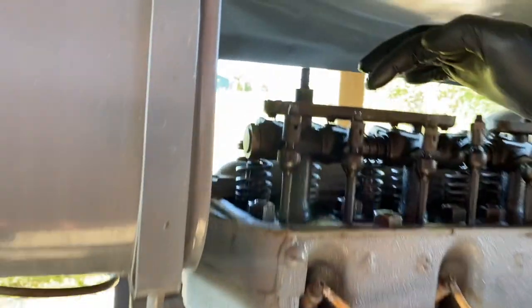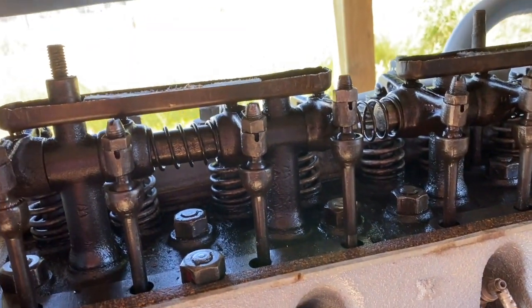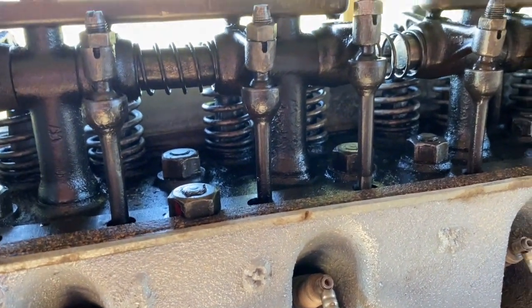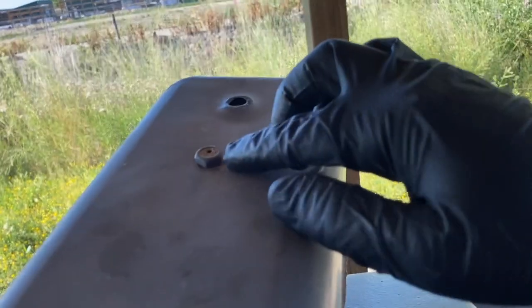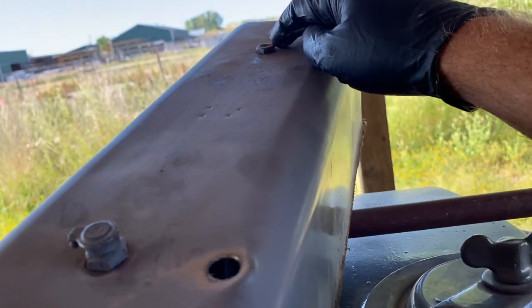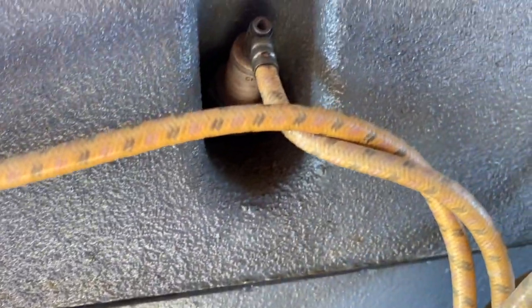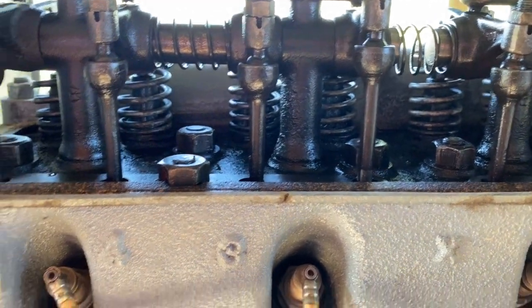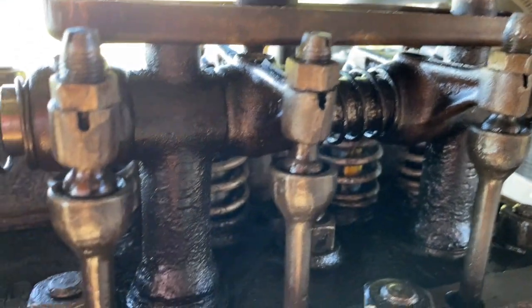These little trays up here, if you can see, they have a bit of felt right in here. A little bit of felt. So I forget where they are exactly. Somewhere in here on the top of the valve cover are these little guys where you can oil the valve train before you start the engine. Must be what that's for. I noticed this side is missing one. I'll have to do without that for now. And maybe I can order one. Anyhow, that makes sense. You dribble oil down into the felt here, and then the felt, there must be perforations in the metal, or otherwise the oil just runs down. Okay, there's a hole on this end, and there's a hole on this end, and there's probably 2 holes. Yep, there's a hole above each rocker arm.